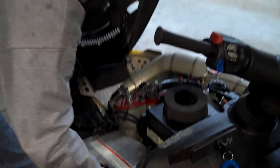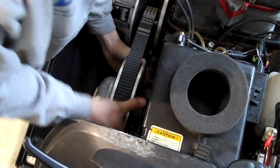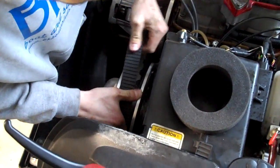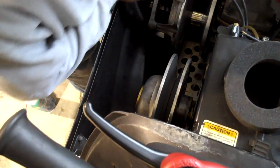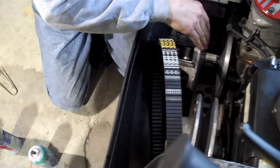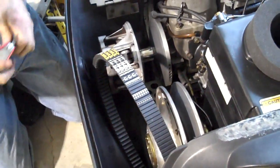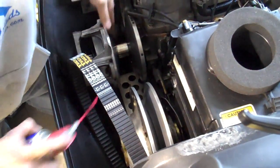The next thing you want to do is get your sled ready for storage, and you don't want to store your sled with the belt on it. It will cause pitting on the sheaves, and we all know how expensive these belts are. I recommend removing the belt — you can just store it in there. But if you leave it on, you'll notice next winter when you pull the sled out there'll be some pitting. Spray some WD-40 on the belt and the sheaves.